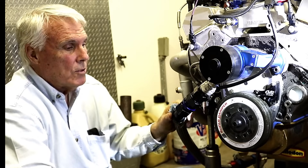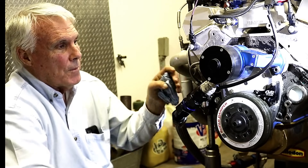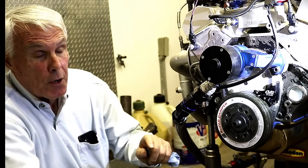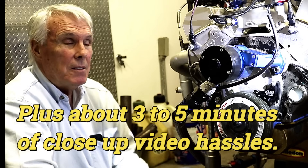You can see how easy it was — not having to disturb the water pump or the dampener or a two-piece timing cover. There's literally four bolts, and I had to take the pointer off because one of the bolts lines up with that. Done, that's it — it couldn't be much easier. All told, it's taken about 15 minutes of no hassle — that's the point, no hassle.